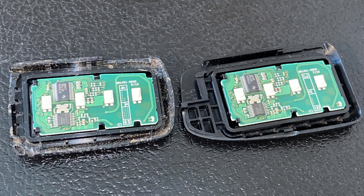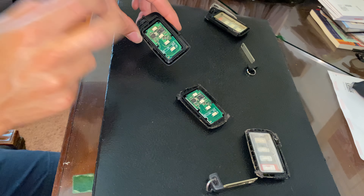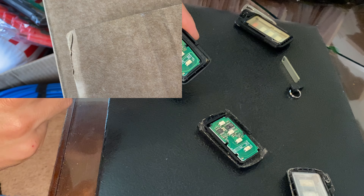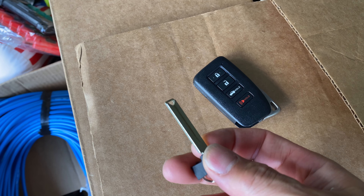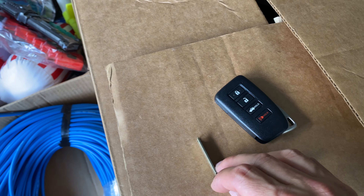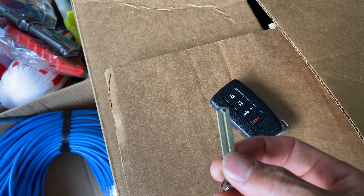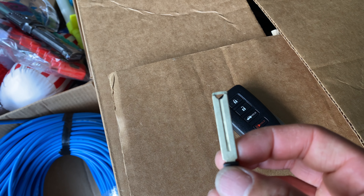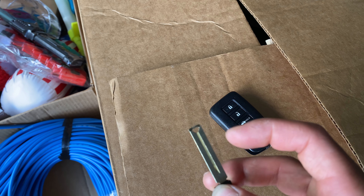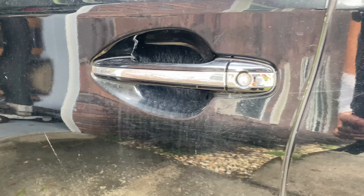In order to program these, they have to be virginized. Usually what they do is get into the EEPROM chip and reset it back so it doesn't have a car attached to the programming, and that's very important when you're buying used keys — you've got to make sure they are virgin keys. This key also came with a blank shank. Getting one of these shanks cut at the dealer is a pain; they usually charge like $50. What I recommend is the link in the description to an eBay seller who will cut the key for you for $15 — all he needs is the code off your lock or a picture of your key. I'll show you later how to find your number using the lock cylinder on your door handle.